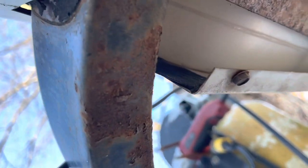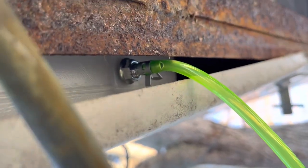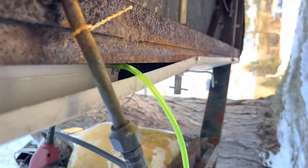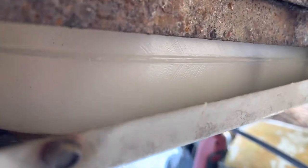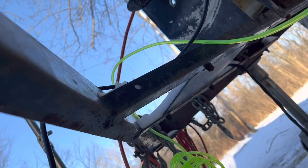All right, so underneath the camper here, we can see our fuel line. And I don't have to drill anything. I am going to foam this in so it's not totally exposed later on when it warms up. It's kind of funny that it separated a little bit. That's how that fit. And it probably wouldn't have fit over here or over there because that's all together still. But whatever. It's better than having to cut the frame up, which I'm not going to do to make this convenient. So cool, huh? All right, I'm going to run the fuel pump way out in the front away from the camper so I don't hear it.